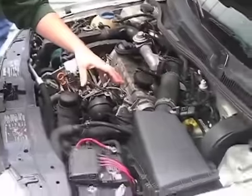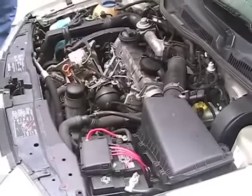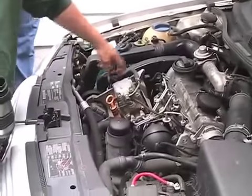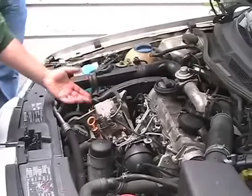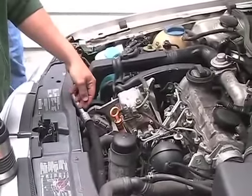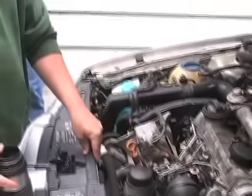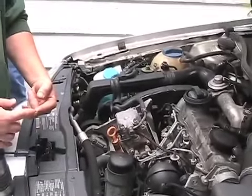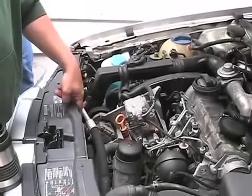I'm going to install the filter and heat exchanger right here in this area, and then the two valves that I mount here and here. I disconnect this line and this line — this is the diesel fuel in, this is the diesel fuel return. The pump brings in more fuel than the engine actually needs. When you switch to vegetable oil, valve A turns on, switching the diesel off and the vegetable oil feeds on. The vegetable oil goes into the pump, comes back, goes into valve B. And there's actually a T-junction before valve B that goes to the filter and back to valve A.